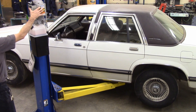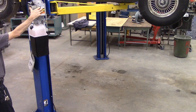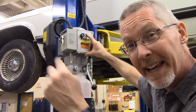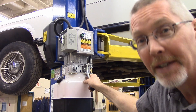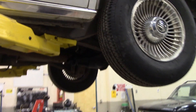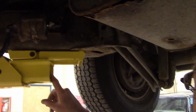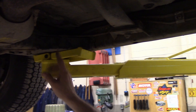Going up. Once you get to the top, we're not going to leave it on the hydraulics — you probably heard the banging of the locks going into place. We're going to let it down gently with this lever and let it rest on the locks. So now it's sitting on the locks — there are no hydraulic rams just itching to leak and squish you. This thing is solid. Looking underneath, that arm is right on the edge of the frame on the front, and same on both sides — it's working for us and is nice and stable.